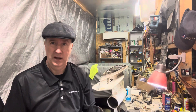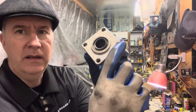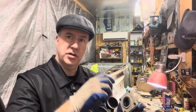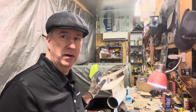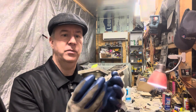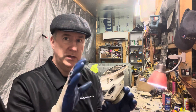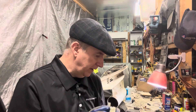Let's take a look at this lower unit and where we're at. We pulled out our bearing carrier — we threaded these holes just enough to drive a couple screws in and pry it up. This is about a '94-'95 motor, and for its age it's actually not that corroded; it looks in pretty good shape. It wasn't leaking from the top seals — we sprayed bubbles on it — but we have a whole seal kit so we're going to pull the seals out. There's also a rubber o-ring that goes around here that we'll replace; we already took that one out.